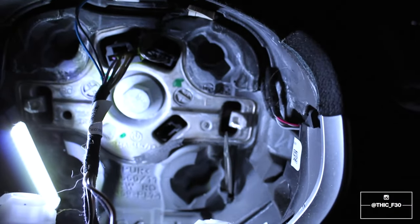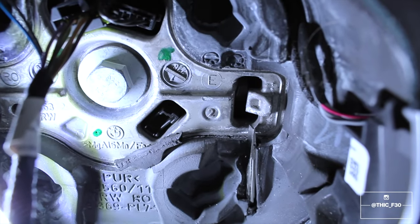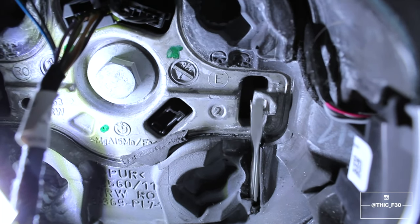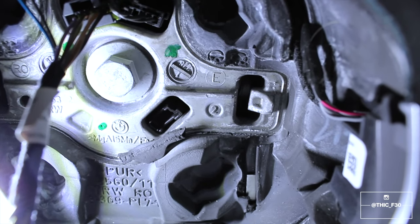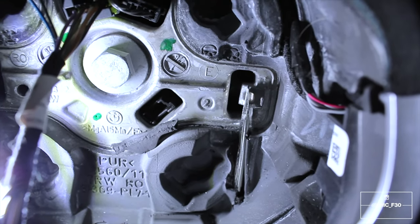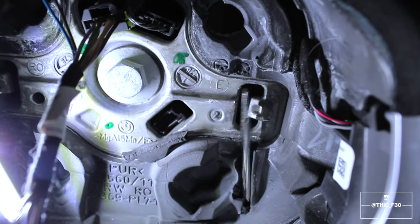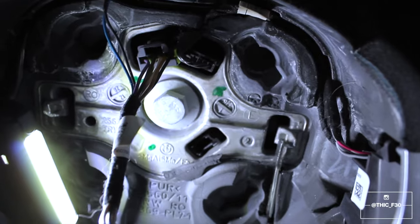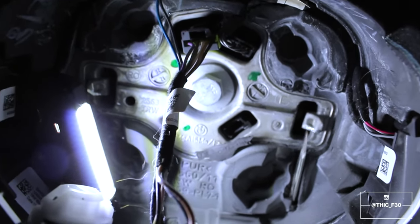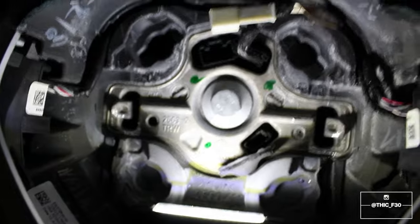So if you look in the steering wheel, you'll see that this comes up like that, right? Your flathead comes in like that. There's essentially a clip that goes around this, and you want to knock it in. So I found that when you put the screwdriver in, right, it should be this way, so it slides in a little bit easier. And then what you want to do is turn it. So it's easier to use the screwdriver like this and unclip that little piece rather than trying to hit it like this. So it wasn't easy, it was tedious, but if you just keep at it, you'll eventually get it. It took a while, but eventually I did get it. And having that separate steering wheel really helped me navigate in here because I knew exactly how far up I had to go with the screwdriver.